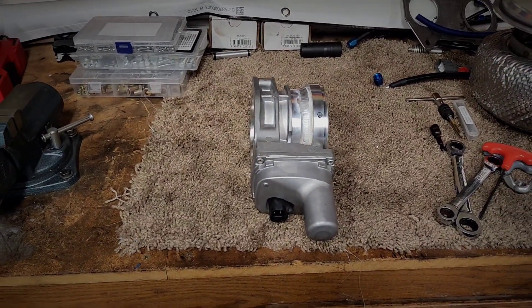You base it on what makes this engine — which is pulling vacuum — respond best with its flow. Air goes in, goes down into the engine, and our job as calibrators is to optimize what's going on with the engine's airflow. If I can control that throttle blade to make it as reactive as possible, that's the goal. It's not about opening quickly — it's about making the engine match that pulse wave of the intake manifold and the charge air going into it. It's a matter of harmonics, port volume, and the surface area and pressures around that throttle body.